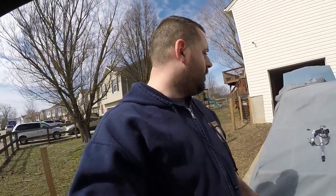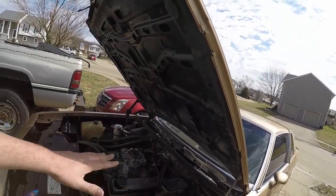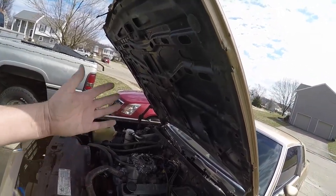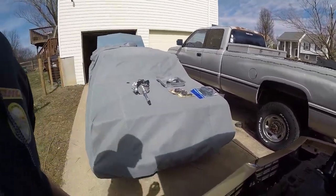At light throttle, something like mid-throttle — at wide open throttle it does nothing. But in between there it gets progressively less impact. From an idle it makes a big difference. It gives more power, more miles per gallon, and it actually makes the motor run cooler. So on a street car, that's something you would want. This distributor without the vacuum canister is fine for race cars where you're just flooring it all the time, but for a street car, having the vacuum canister is much better.